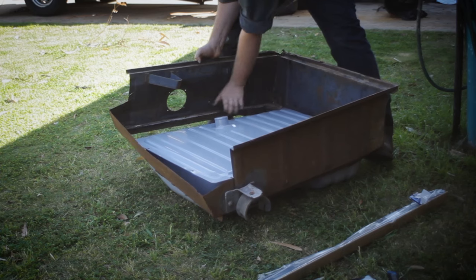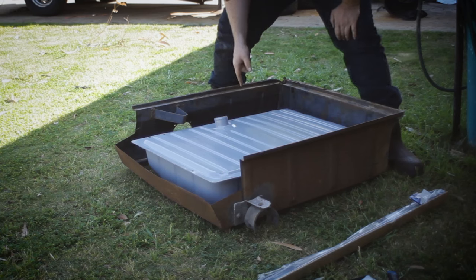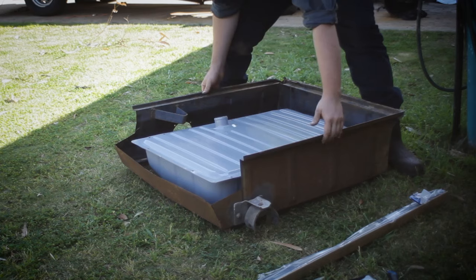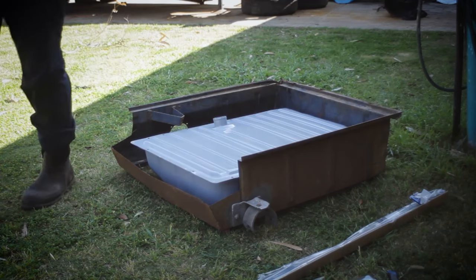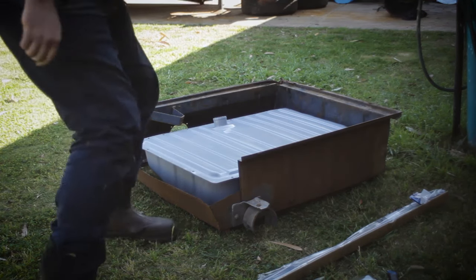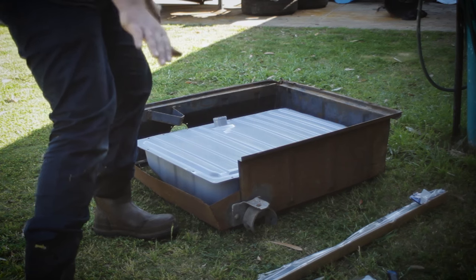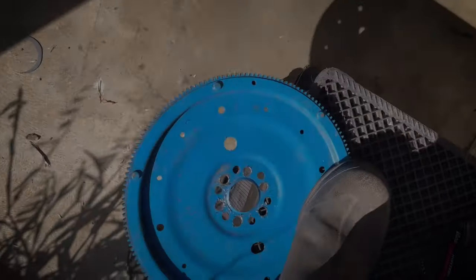This void here can be filled in with just a piece of metal. If you're looking for a petrol tank for your '66 through '71 XR to XY Falcon wagon, you can't get wagon tanks for this generation of Falcon - but a '65 Mustang tank is going to fit in no problem. An amendment though: a sedan tank doesn't fit. I've already got a physical sedan tank to try fitting it into this hole - no go, dimensions are all off. Not gonna work.